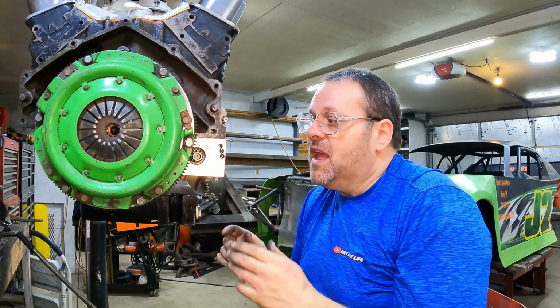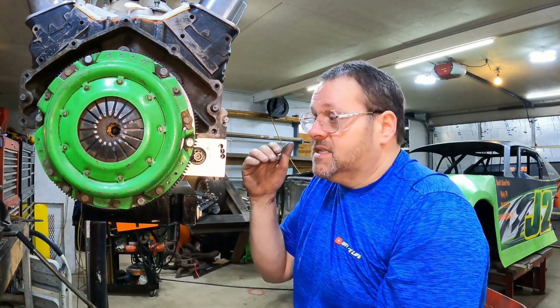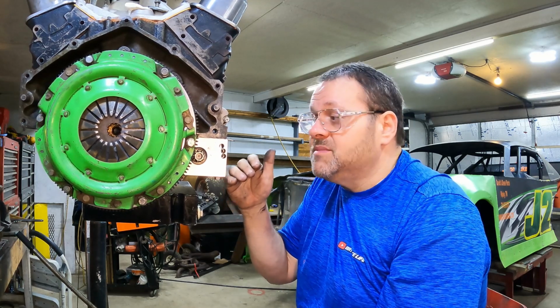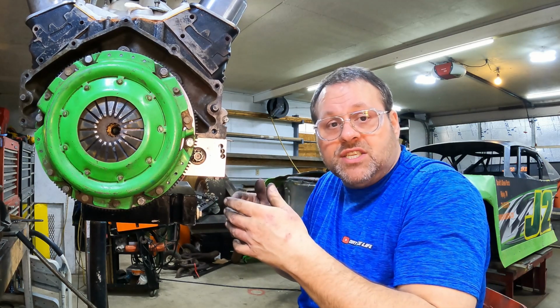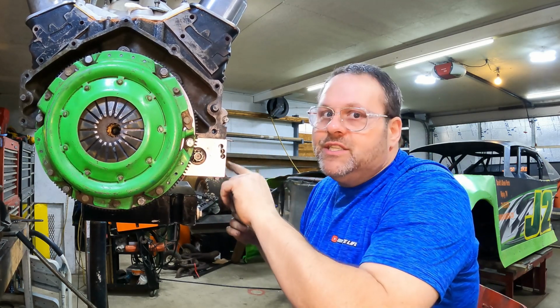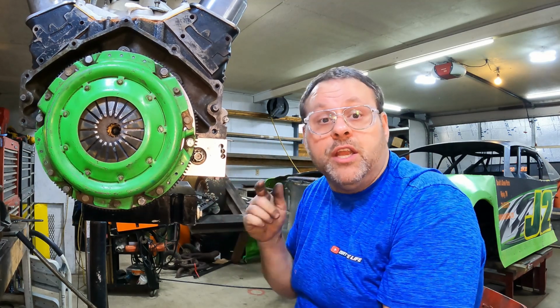One more point. It's gonna change as far as the number of shims from block to block. It's gonna change as far as number of shims starter to starter. So every time you break up and change combination between block and starter, do it again, folks. I know it can be a total pain when it's under the car. You know what's a worse pain? Being down at the racetrack, having a good car and not being able to race. That right there gets on my nerves.